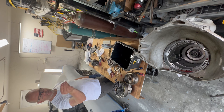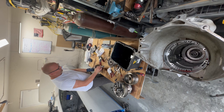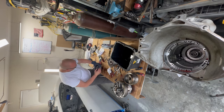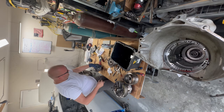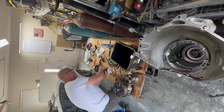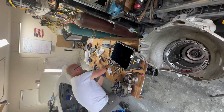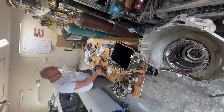This drive here — I got this all assembled. It's pretty straightforward: clutches pop back together, change all your stuff. This is what's going to help make it rated for higher horsepower — this is a 1200 horsepower shaft from Summit; I'll put the link in the video description. I did not have the right snap ring on there, so I took it all back apart and put the right one in. There's probably somebody watching this who does transmissions and likes to critique, but the diagram shows it as that ring, so I wanted to make sure I had it right.